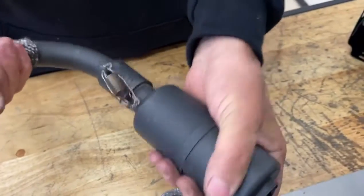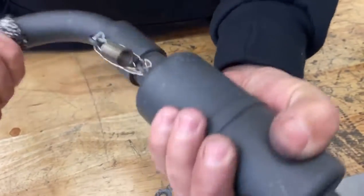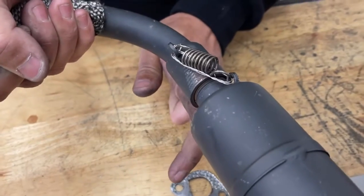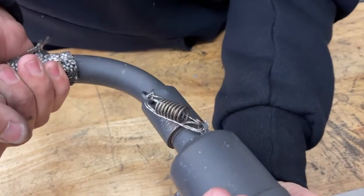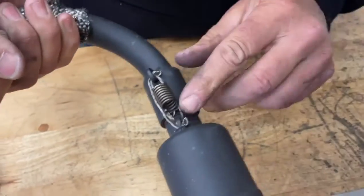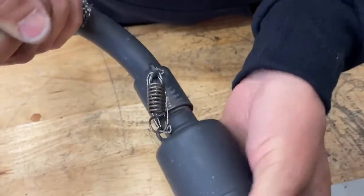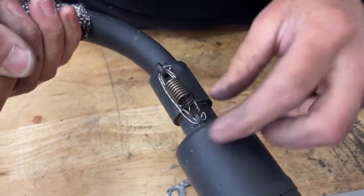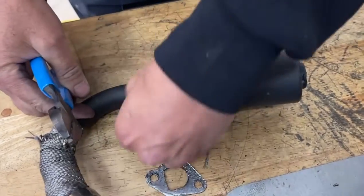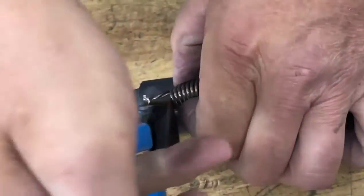Here's our muffler — it's loose because exhaust will pass those threads. If I go all the way tight right there, I could get this all the way to the other side, but I won't push it that far. So I'm loose, but not that loose. You have this spring on here from that loop to that loop. If that spring breaks and this muffler comes off, you're DQ'd. So we always safety wire it onto the pipe, and since I've seen the safety wire broken before, I always double it up.